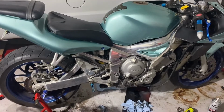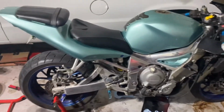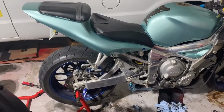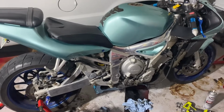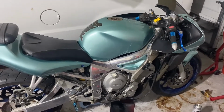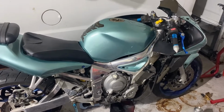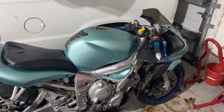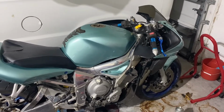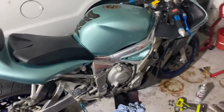There's no leaking, no oil, no leaks anywhere. I'm gonna change the brake pad. So I got a lot I'm gonna do for it. But for now, just cleaning the carb, that's the main thing, because I have a feeling it's all gunked up. It runs with the choke on, but when you hit that choke off, it wants to die. So I'm pretty sure the pilot is probably gummed up in there.